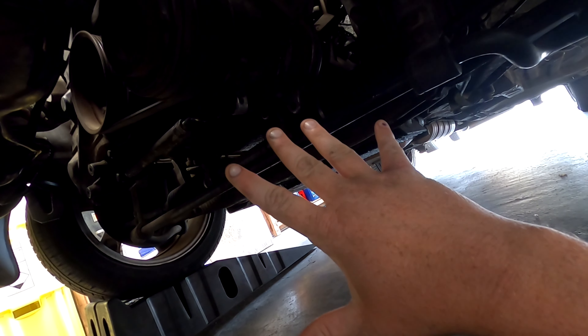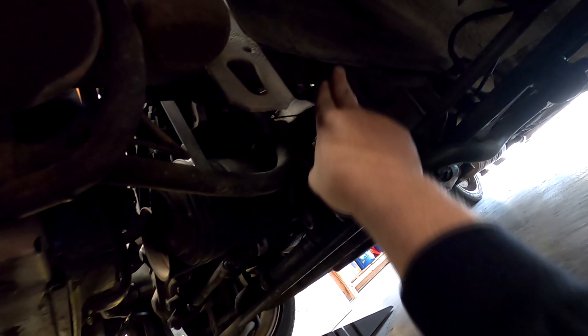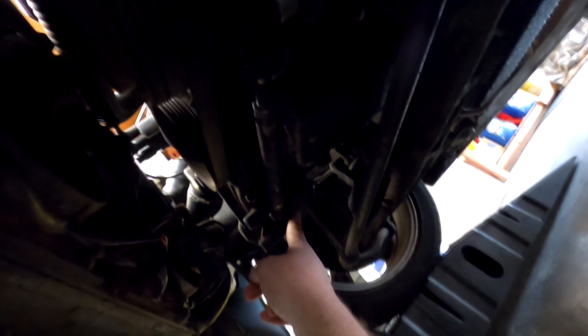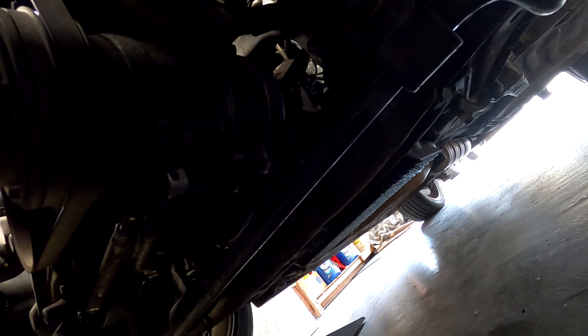It's probably hard to see. I've done this one time already and I can't remember the steps I took. But basically what we're going to do is take these four bolts out and drop the sway bar down out of the way. You could use a jack with a big piece of wood on the oil pan to hold the motor, or you could get it from the power steering mount right here — my car doesn't have it. There's a bolt under here and two bolts on each motor mount. I unbolted the subframe with the bolts in but really loose, got a pry bar, pried it down, and was able to pop each motor mount out.